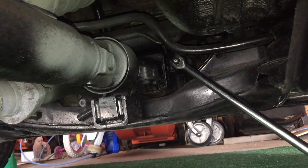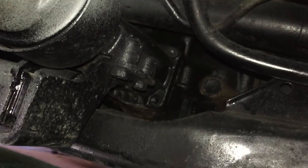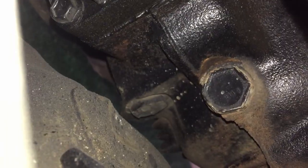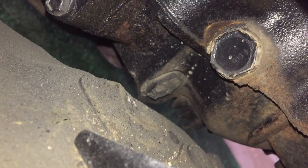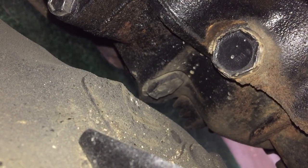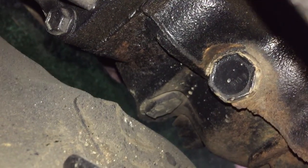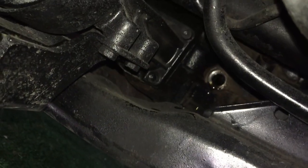I'll show you how it looks. I can remove it — remove the socket — there you go. There's the bolt you need, and under it, there you go. The top one is the bolt for filling and the bottom one is for draining, but the bottom one is very hard to access and you need a proper tool for it. So I'm just going to use the top one to drain and to fill using a large syringe. It's a 24 millimeter bolt and it's now just dripping.